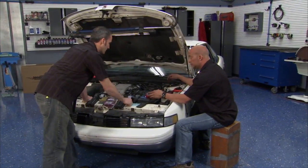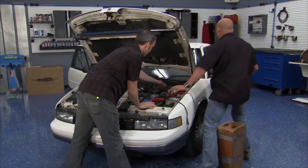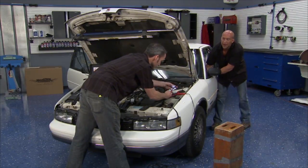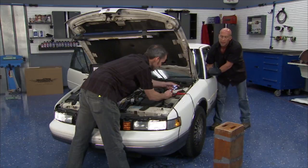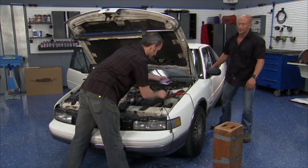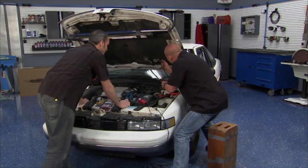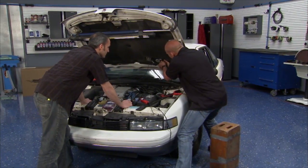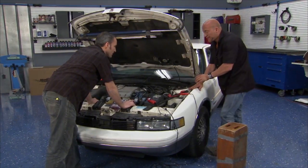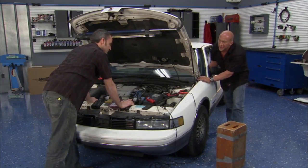Since it's messing with the parking lights, maybe we check that switch. Let me hit the switch and see if you've got any volts there. It's actually sending power here, so we've got power now to the switch. I bet if we plug this guy back in, it might be that easy. What this Power Probe is telling us is that if we turn this switch on, that light ought to work and our buddy's going to be really embarrassed.